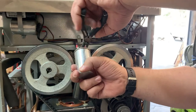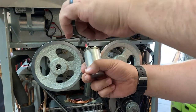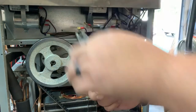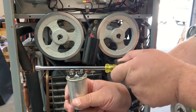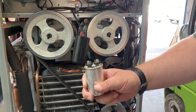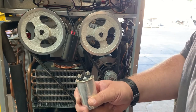What I'm going to do is just go ahead and take my needle nose pliers — and just remember how those wires were connected before you take them off. Then what we're going to do is take a screwdriver or something similar, go right across those terminals. Sometimes it'll spark, because these can actually shock you. If it sparks, it means it's charged. If it doesn't spark, you're safe.